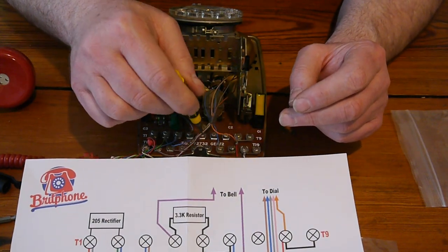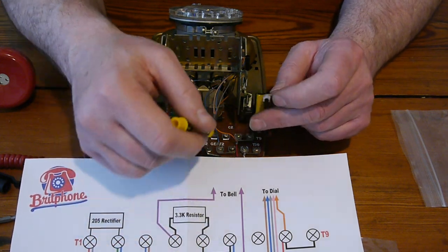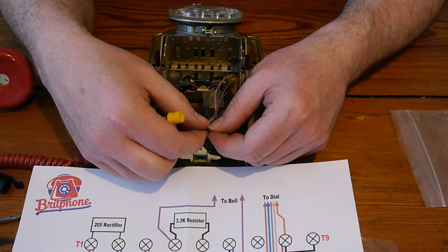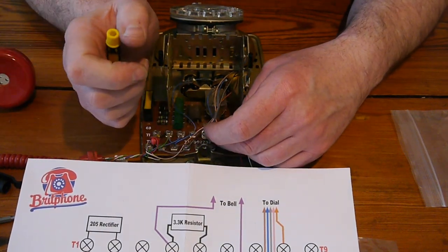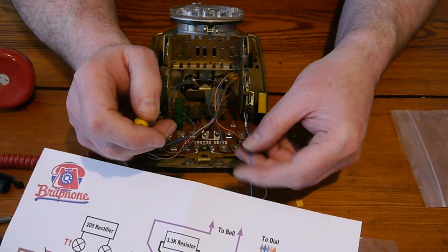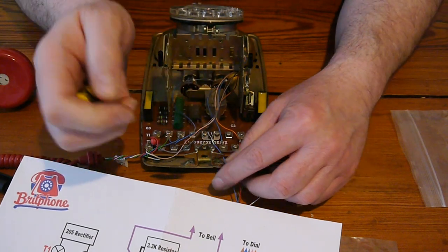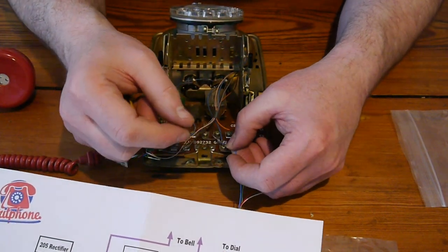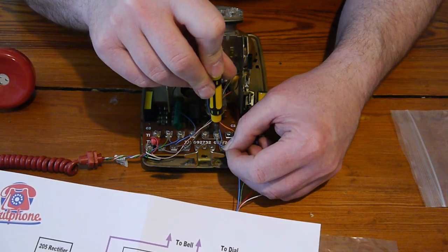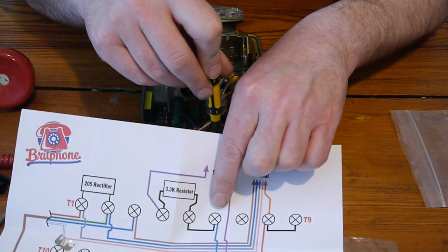Right, we've taken out all three connectors between these four. As you can see, those four don't have three connectors. They have one connector between this one, the middle one, and the other middle one. So we're going to put this shim back in. It's a little fiddly. It wants to go underneath the screwdriver bits. Right, and also this side of the shim is the blue wire. So we're going to get the blue wire and we're going to slip it under, and I can't show you because my fingers are in the way. I'm going to slip it under and I will get my hand out the way as soon as it starts gripping. There you are. The blue wire is now underneath this terminal.